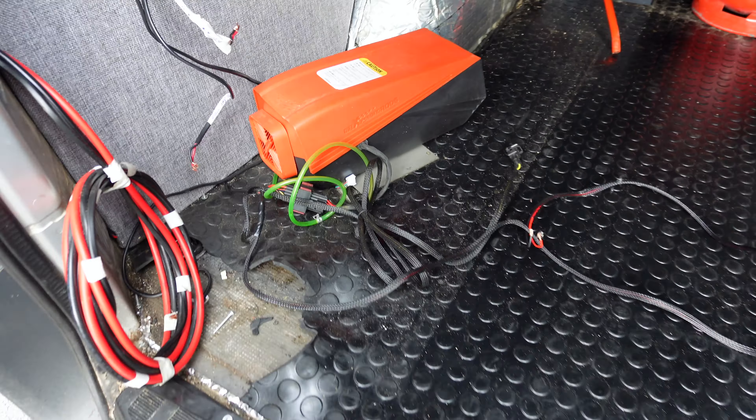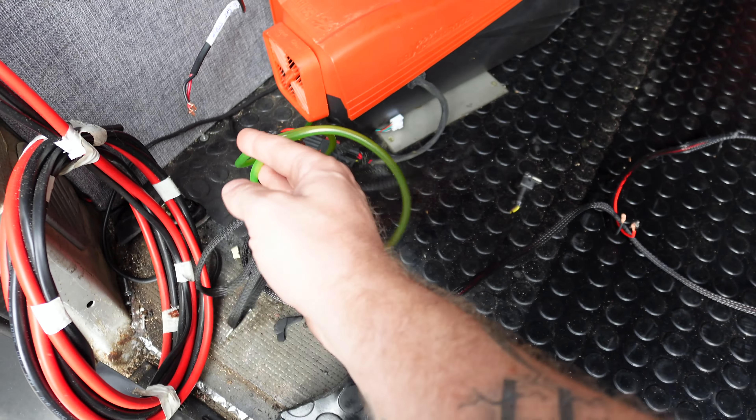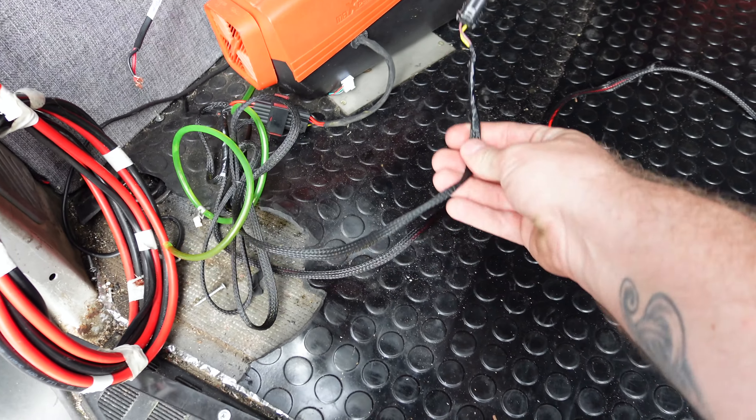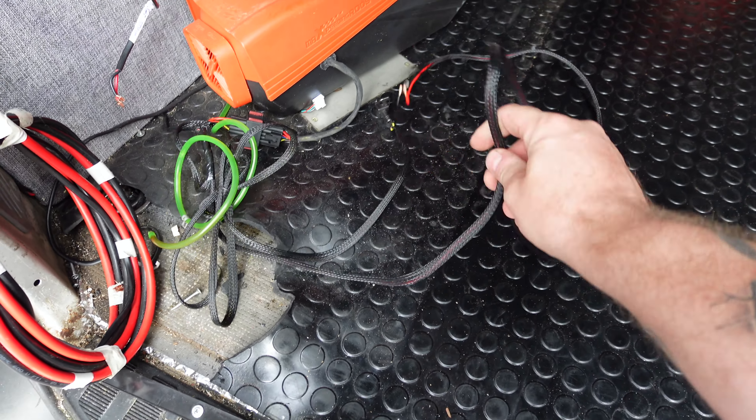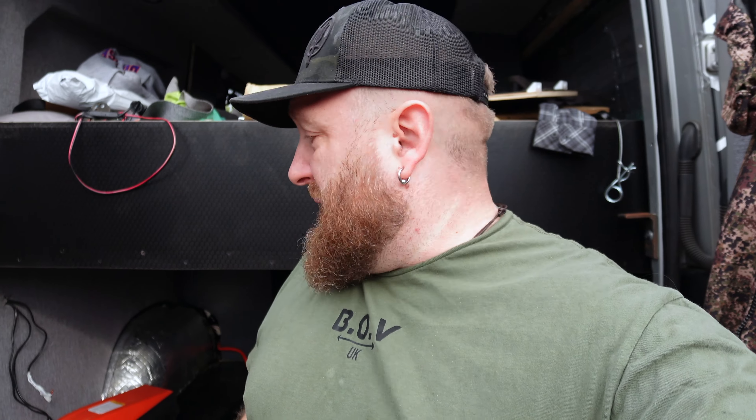So, you have to go. You've got the air in and exhaust underneath, you've got the diesel in which goes underneath, and then this goes to the control unit and this goes to the fuse board for power. So that's going to come out. They are great as a budget item - if you haven't got heat in your van and you haven't got a great deal of budget, they are absolutely fantastic. However, with this Sprinter build, this is the first time in my life I'm going pure quality where I can. So, that served a purpose for last winter, now we're going to fit the quality kit, which is the Autoterm kit.